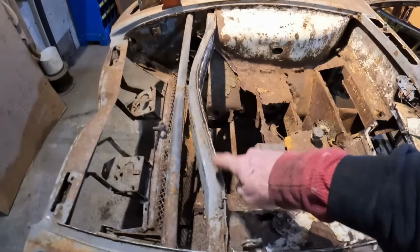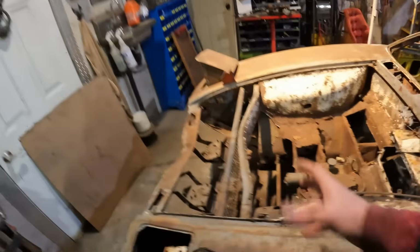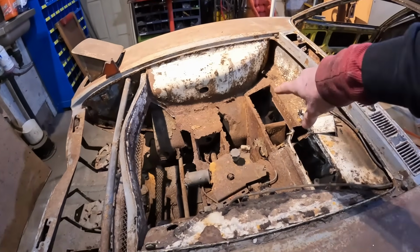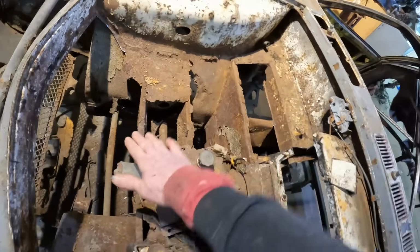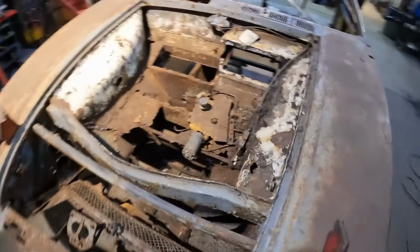This bar travels underneath the fender there, and there's a plate in there, so I think I can keep that part separate. And the front suspension actually is attached to this wall here, so I think I'm just going to cut from pretty much here across, down, and off. And I don't know how that's going to be hacked apart, but since I'm out of acetylene now, it's going to be all done with a Sawzall. So let's time lapse some of that and get this front end down.